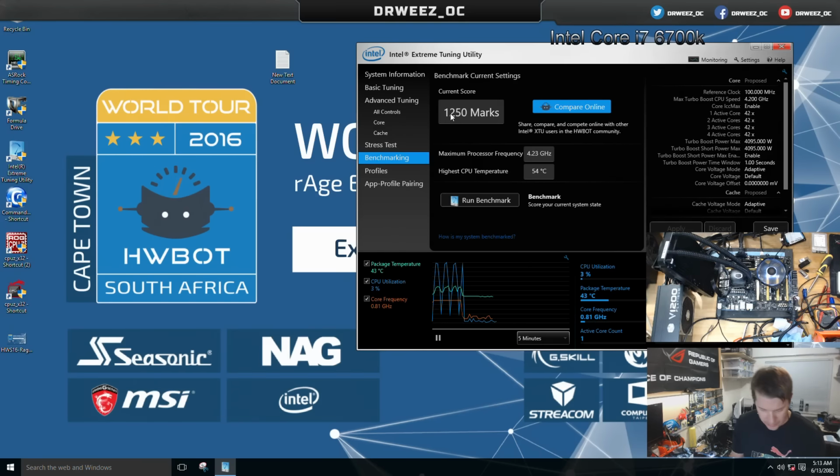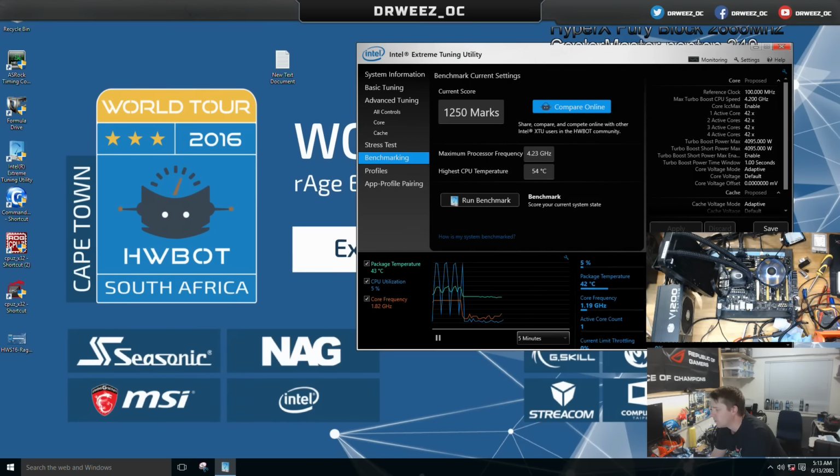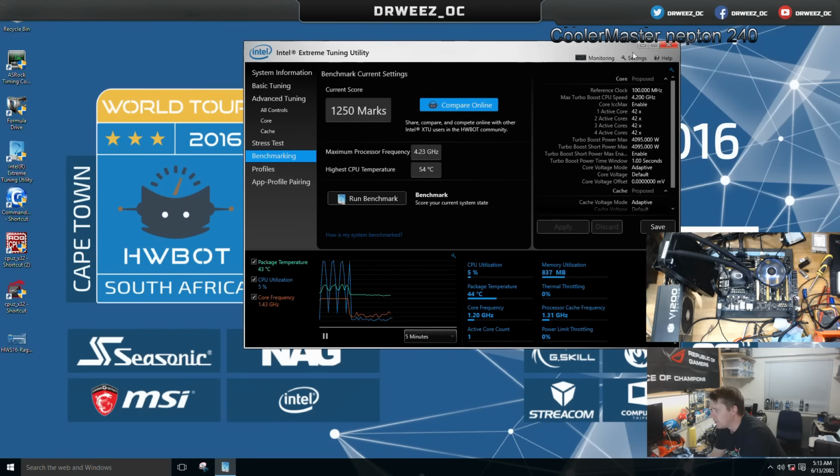So the first thing we're going to do is start moving our CPU up. I want to try and get to 5 gig, if I can, 5.1 on all-in-one, which would be quite nice. But it's a lot to ask, because with XTU you've got to start managing your temperatures. Then once we've done that, we'll come back to some of the XTU configurations that are also very helpful when overclocking on air. So, in fact, let's go through that first.